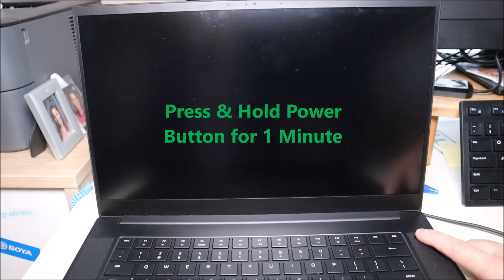So after removing your battery and unplugging your charger, you're going to press and hold your power button for one minute to drain that power from your computer. After pressing and holding the power button for one minute, plug in your charger, leave the battery out, and try to turn on your computer. If your computer turns on, it could have just been a power buildup issue. Put the battery back in, see if your computer runs like normal. If you have to do this without the battery to get your computer started over and over, you may want to look at getting a new battery — something's wrong with your battery. This goes the reverse way too: if you try starting your computer and it doesn't start, unplug your charger, press and hold the power button for another minute, then put your battery back in, leave the charger unplugged, and try to turn on your computer. If you have to do this every time with your charger unplugged, something's wrong with your charger — consider replacing it.